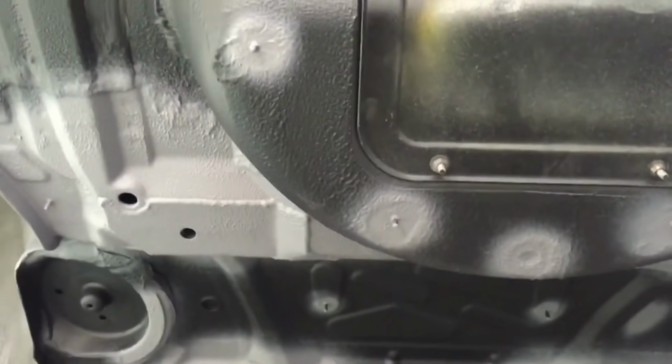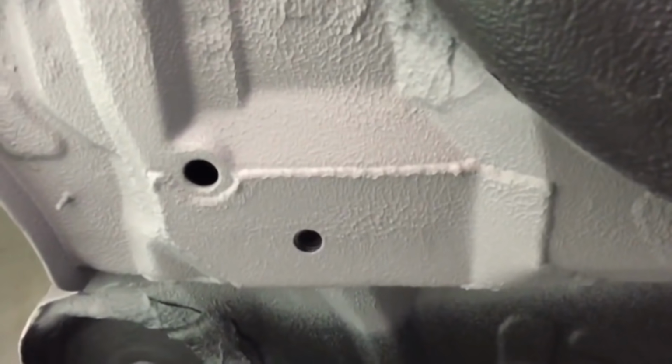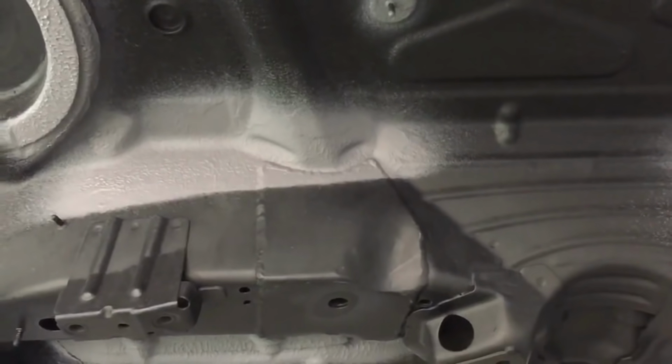So this is the final video of the CSL before paint. It's just had this sprayable seam sealer, which is this textured finish here. That's looking at the left rear plate, and we've tried to replicate the factory lines where the factory robots do the spray seam sealer. That's just going across the top left to join up with the textured top side. These front sections don't have any. Now it's trying to revisit the join. That's a factory one up there, sort of going in a sprayed arc. And then we've got replacing seam sealer on areas that we had to remove for our corrosion work.